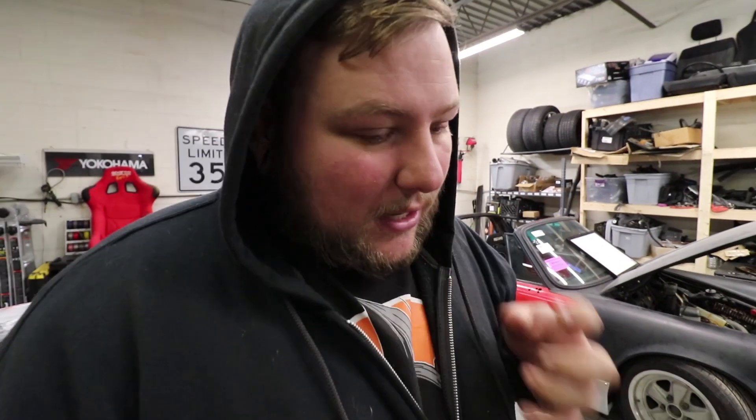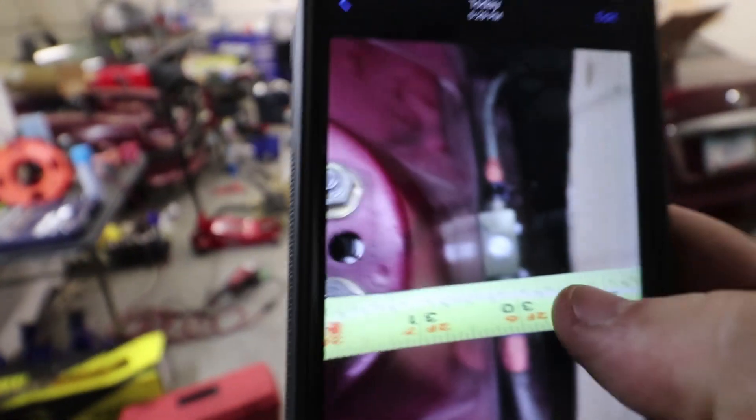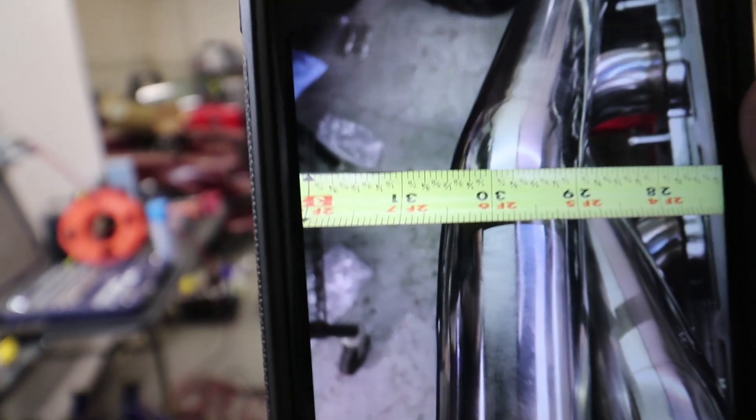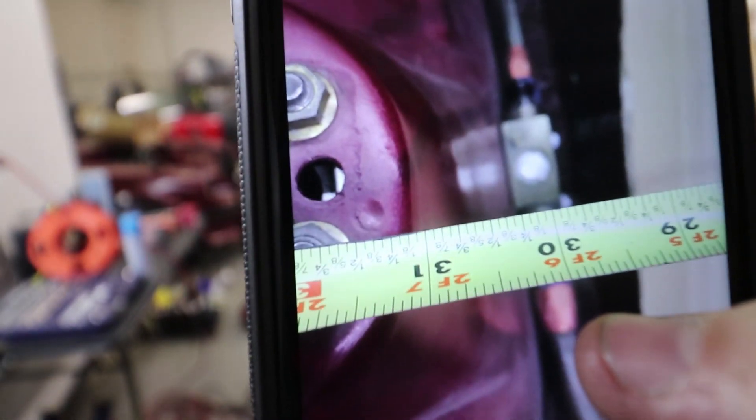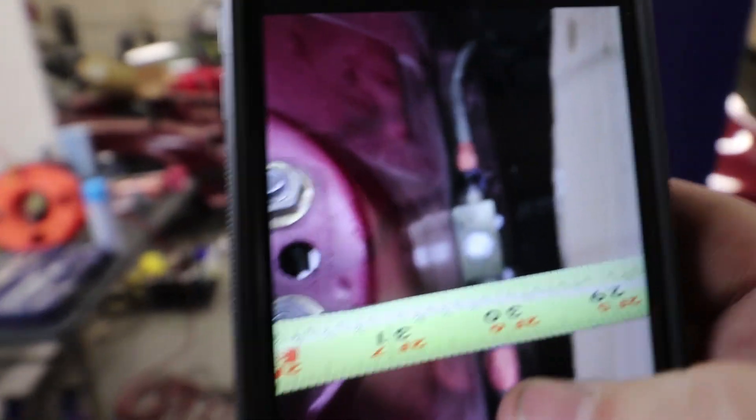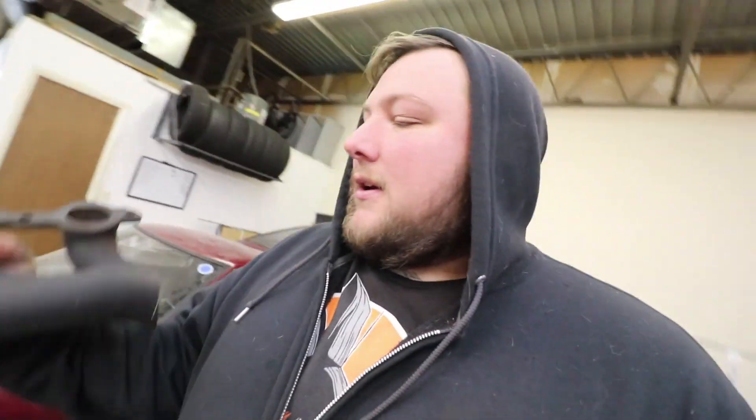These manifolds — we tried to use some nice big tubular manifolds and here's what it looks like with the manifolds on. Looks pretty cool. But measuring it out, it goes about 30 and a half to a little over 31 inches, so we'd have like a quarter to an eighth of an inch on each side between the shock towers. That just wasn't realistic — kind of sucks but it's okay. So what we're gonna do is use factory manifolds that John found in his yard under a hood. I cleaned them up and painted them a little bit just to have them looking nicer.